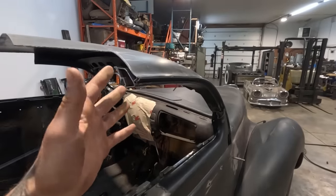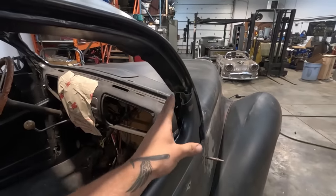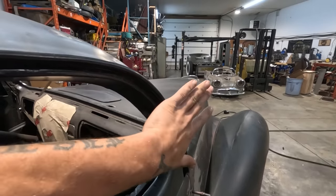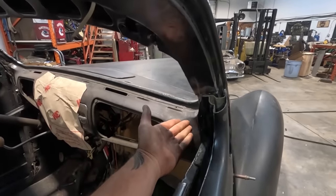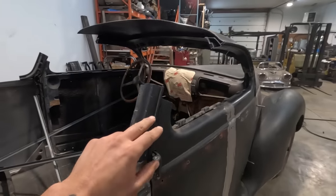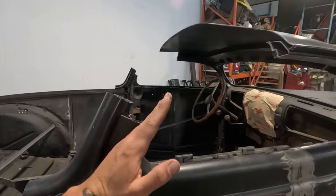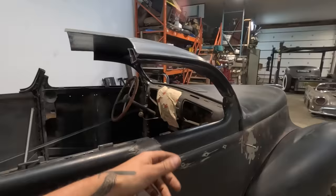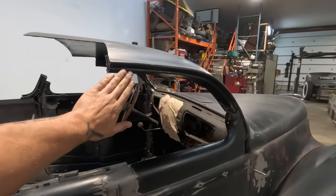You know, if you can have a slightly smaller panel because we left an extra 6 inches on here, then that's a good thing. The next thing that has to happen here now is that I need to tip these door pillars in. The actual door itself, because these outer pillars, the A pillars, got tipped in slightly when we were aligning these, the doors also have to be. So I'm gonna have to make a cut in here that allows this to tip in a little bit, as well as the same thing at the back. And I'll likely tighten up this pillar by pie cutting this way to have more of a flowy door top. But that's sort of next. Make these aligned with the new plane of the door jam.